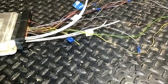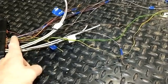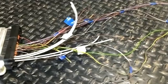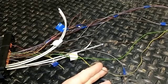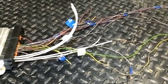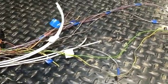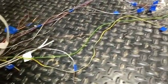I did make the mistake of thinking all of my scrap wire I've been using would work for it, but these pins are so small that the industrial wire's shielding is just way too thick to work in these little ECU plugs. So I've been scavenging some wiring out of the dash sections of stuff that's been pulled out, because it hasn't been exposed to much so it really feels like new. Obviously you can get a whole roll, but I didn't feel like waiting a few weeks for it to arrive.